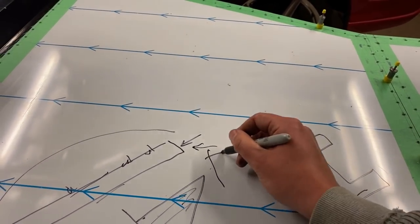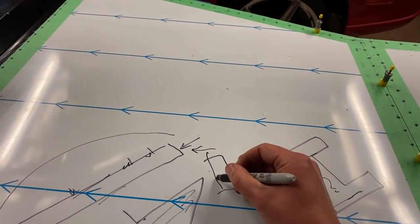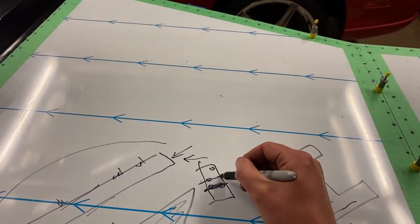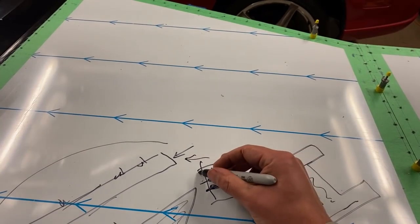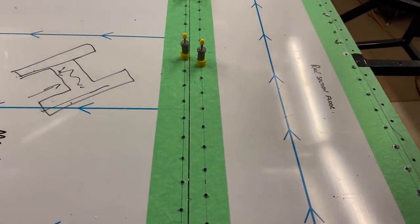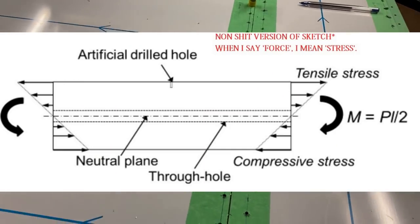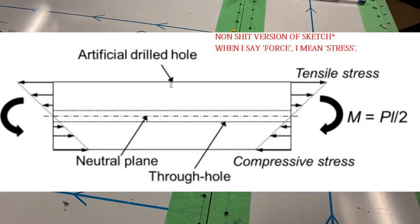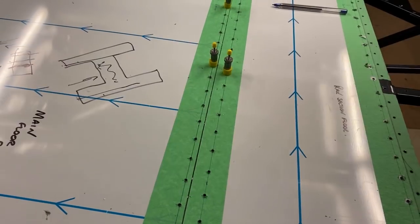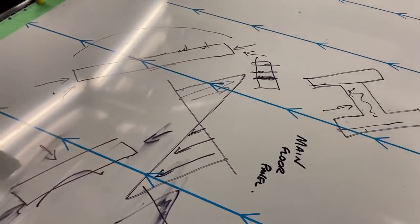So we don't want to be drilling too many holes and taking too much material out. If you look at the top section and have two holes drilled right next to each other, you're actually taking a lot of material out in that direction. Whereas if you offset them, you're only taking out one drill hole's worth of material at any one point. That's the reason I recommend just offset drilling those. Without knowing the actual forces occurring in this section of the chassis I don't know whether it's close to its maximum capability, but there's absolutely no reason not to offset drill it.